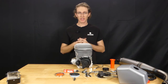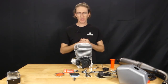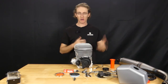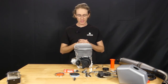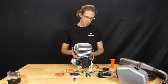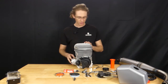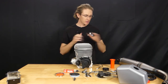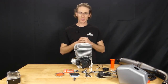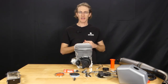At center stage of this engine package is of course the Vortex Mini-Rock engine itself. When it's delivered in the engine package it doesn't have a carburetor or exhaust installed on it, but it is a complete ready-to-go engine with both the head, the crankcase, and all the internals installed, as well as the starter and the main coil wire. All the other externals would be something that we're going to have to put together, and we're going to check that out in a little bit.